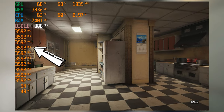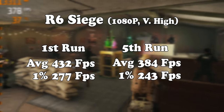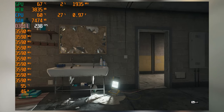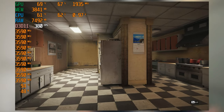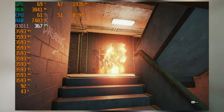I redid the benchmarks after about five runs while the VRM was nice and hot, with Rainbow Six Siege. If you just game for three minutes, the systems perform very similarly. But if you extend it to a longer period, it starts looking worse for the Little Loser motherboard. Still very good, but not as good as it was in the motherboard that makes more sense for it.